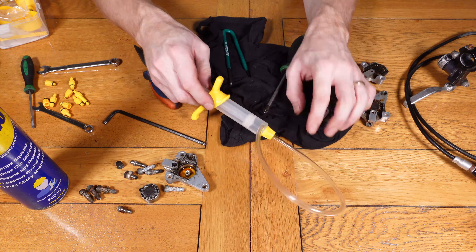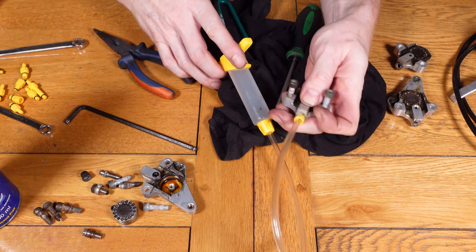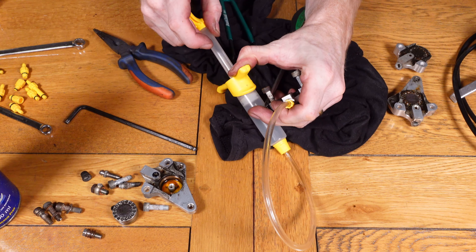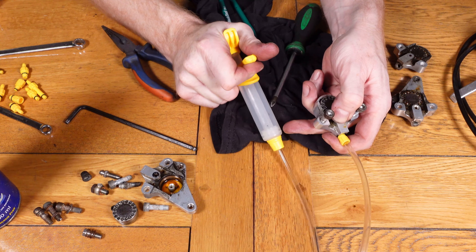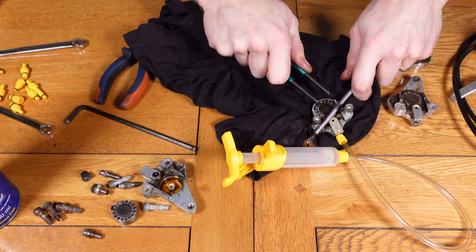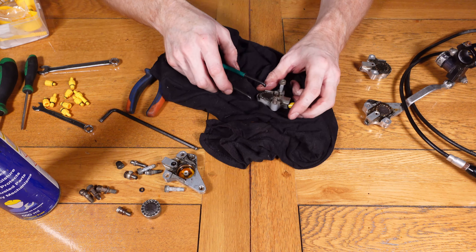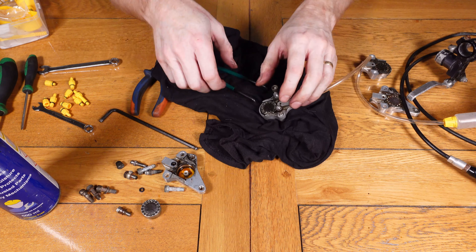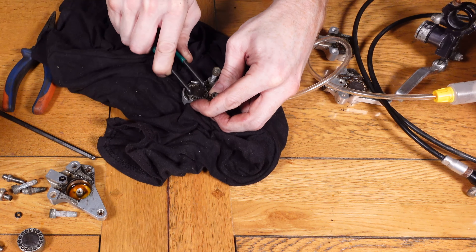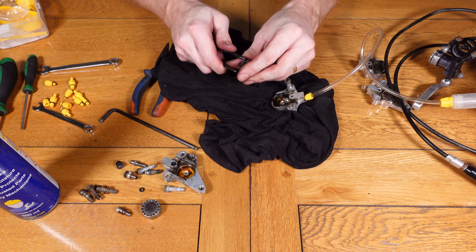When you're doing this, put the hose in — I'm using a brake bleed tool to do this. Cover the hole which normally carries the oil from one side of the caliper to the other, and then apply pressure. You can see at the moment this isn't having any effect on the piston, so I'll try turning it a little bit more to see whether it loosens it. Be mindful when applying air pressure that the piston is under pressure, so don't aim it at your face or anything it might fly off and hit. At this point I had to get someone to help me apply the air pressure whilst I turned the piston. You can see straight away this is the best way of doing it — getting the pressure in while turning the piston allows it to come out a lot easier.